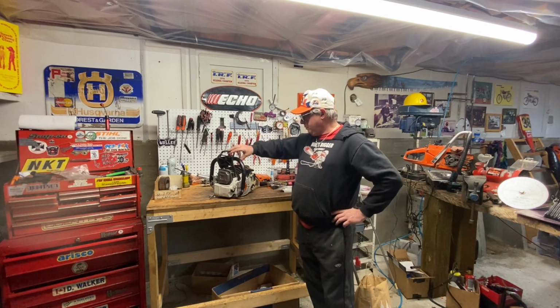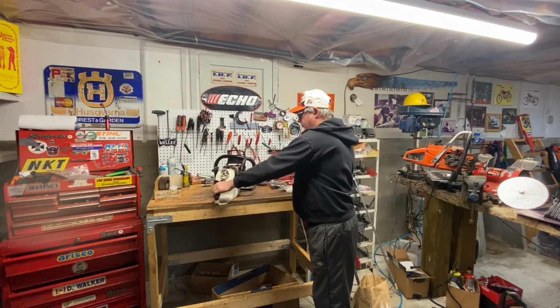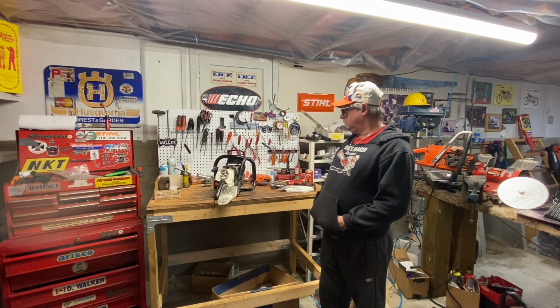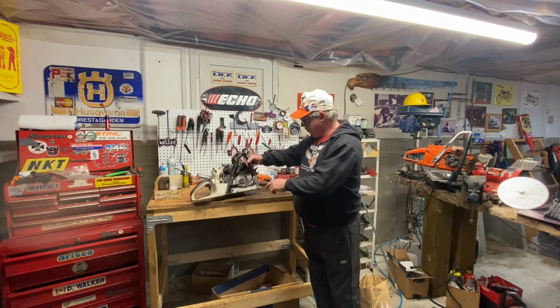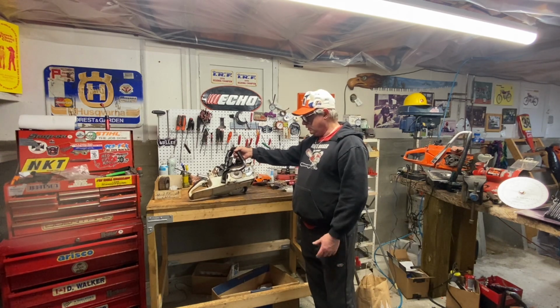You're going to do some upgrades for sure for the West Coast wood. But overall, they've been working very well. There's been some issues with them, but nothing to really be worried about. They are a little weak in some areas. You need to change that bar plate to the better one, the old 0661 or 0461, because the new ones they come with are just a piece of tin garbage.